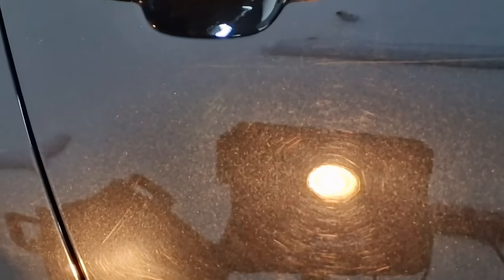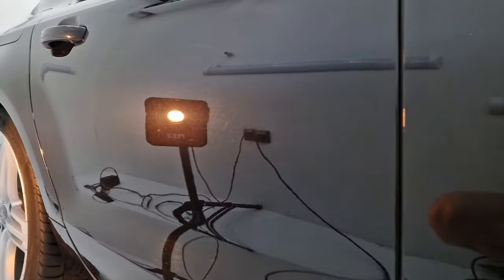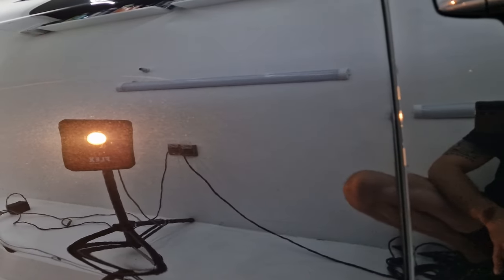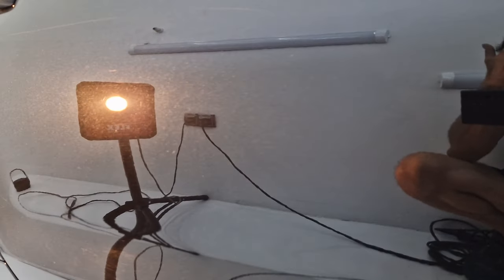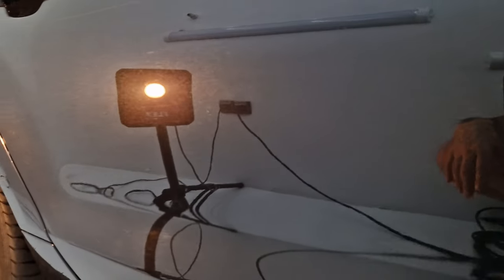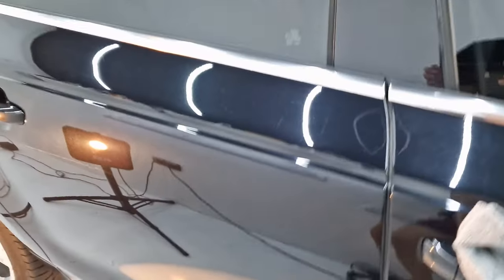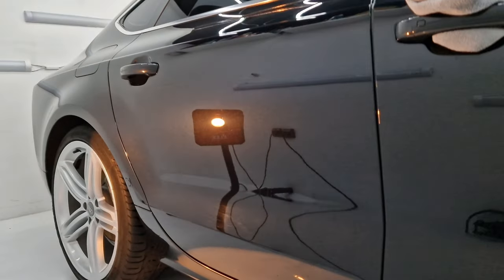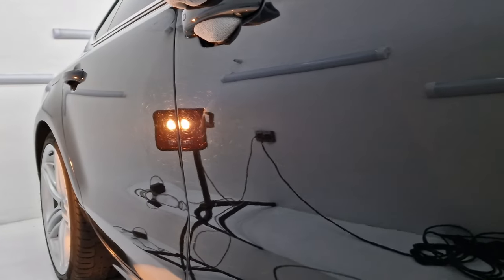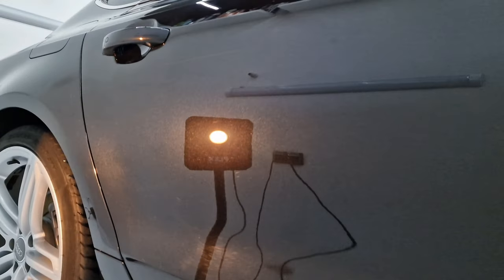After removing those 50%, this is what you're left with. If you want to do quality work with one-step polishing, you can finish the car in about four or five hours working alone. My advice: use a paste without fillers that won't just wash off, and use one that has a lot of shine and will get the job done. The most important part is finding the correct combination of materials — using a microfiber pad and a double action machine, not a rotary, because a rotary will just make holograms.